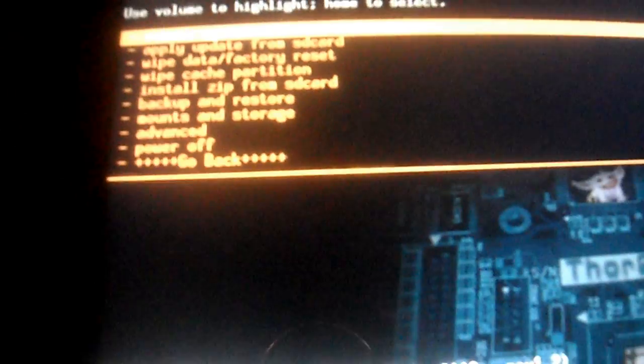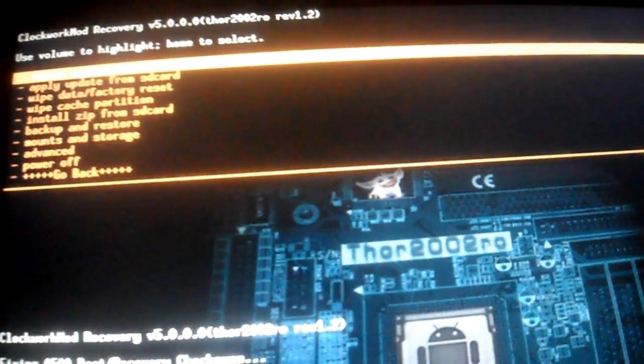You're going to have to turn off your Iconia. Then you're going to boot into ClockworkMod Recovery by holding the power key and the down key, which is the far left part of the volume key. Keep holding it until you see a fourth line pop up that says 'booting recovery kernel image,' and you'll be booted into ClockworkMod Recovery.